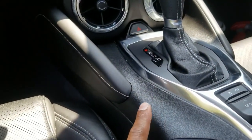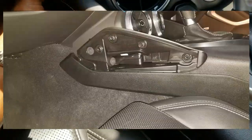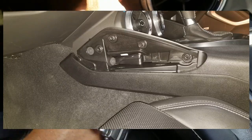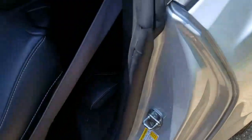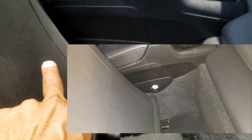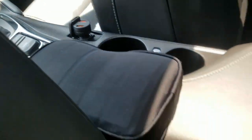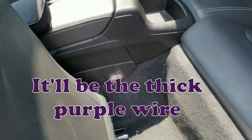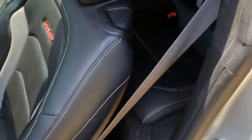The little leather part right here — grab it towards the front and push it up. Once you get that up, there are two 10-millimeter bolts in here and another 10-millimeter bolt in the back. Same on the other side. Lift this up and the cigarette lighter right there — that's going to be your remote turn-on, only on when the car is actually on. That's where you get your remote wire from.